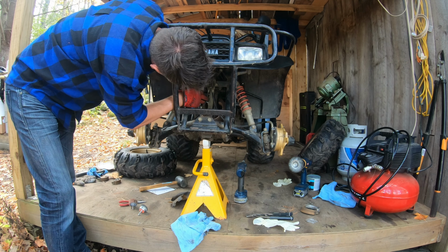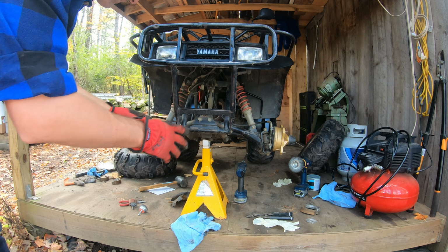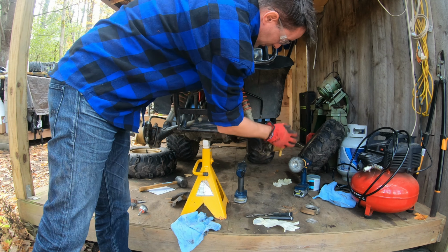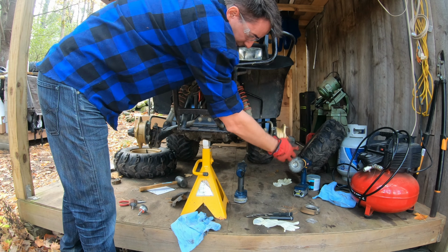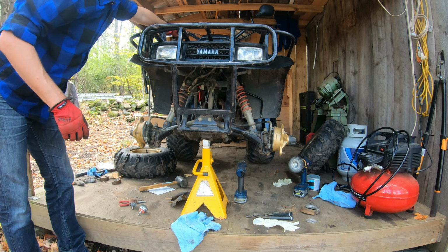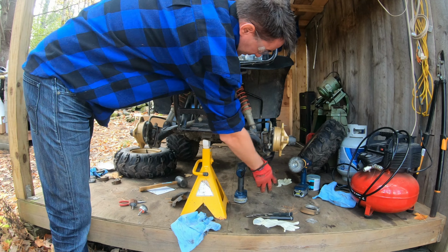Pull the lever all the way. We're really pulling even. That one's getting good, not so much. So we want to match them, which is to say, I think we're going to start one, two, three, four. So that's two turns on there. Everything still spins. Grab it. Pretty good. Still wants to break out. How's my pull? Pull is still pretty even. One, two, three, four. Still have neutral.